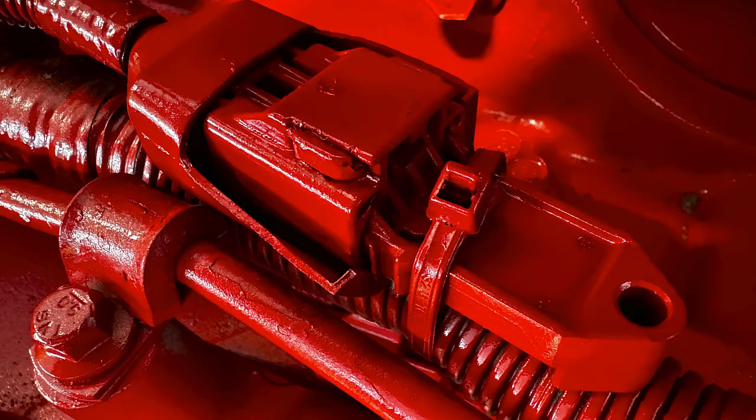Even though this is a very small, very light sensor, it's very powerful. When you turn the key on, if you have Insight and go to the data logger monitor and click 'All Parameters,' you can look down the list for 'Ambient Air Pressure Sensor.' It should be reading whatever your barometer reads at your location, plus or minus 0.5. If it's beyond that, you might want to change the sensor to get a good accurate reading.